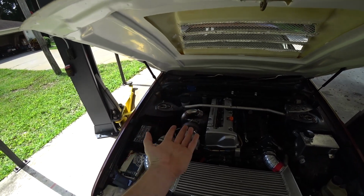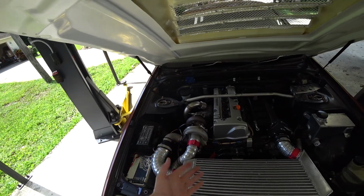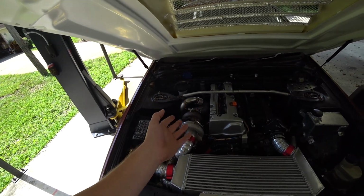And like I said, I'm confident at least that bolt touching is a big contributing factor because the engine is basically sitting against the chassis, so any resonance is going to travel through, and it's going to be kind of intermittent as it moves around on the mounts.